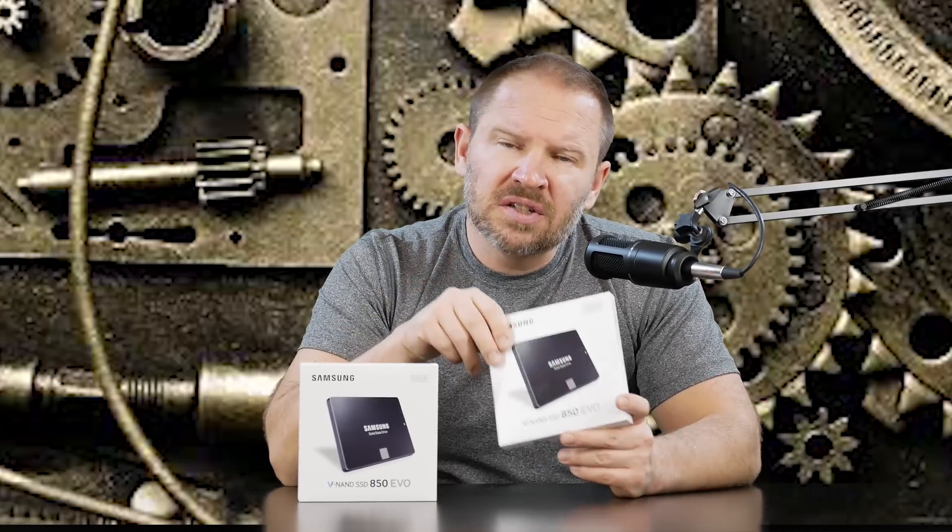You might be wondering why I bought two, and why a 500 and a 250. Well, there's some strategy here. The 250 is going to be for my operating system drive. I've currently got an older 128GB in there and it's a little small. I used to run the system with the page file disabled — that's one of the tweaks you can do with SSDs to make things run faster — but I re-enabled it because the system seemed to run a little faster with it on. With the media cache from Adobe and the bloat of today's software, and having the full Adobe suite, I just wanted a bigger SSD. So I'm going from 128 to 250 gigs.